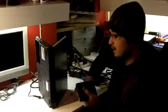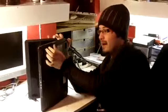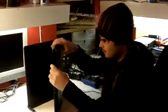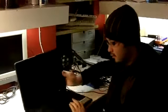But the reason why I'm 100% positive that it is the DC socket is because when I plug the battery back, because there's a little bit of charge in that battery, just a little bit, if you come closer, the battery alone on the laptop lets me see lights, lets me see power. This tells me the laptop will power on. This tells me there is a bit of hope. But most of the time, people's batteries are always dead, they never charge them. So if your battery is dead, it also means you won't get any life from it.